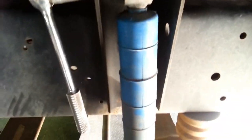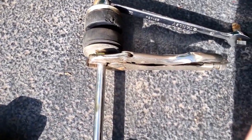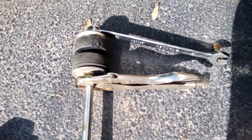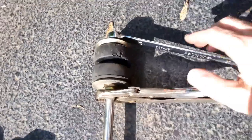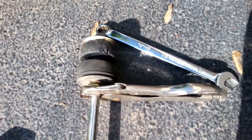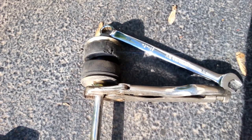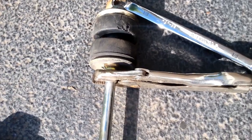It really went no problem. I cut the fronts off fairly easy, then went to the backs - about the same. For the back shocks, I have a 2005, and I think around 2004 or so they changed the design. So for 2004 and forward you have this style of shock where you've got the nut on top. If you're going to order some for yours, crawl under there and make sure you're ordering the right set of shocks so you don't get the wrong ones.